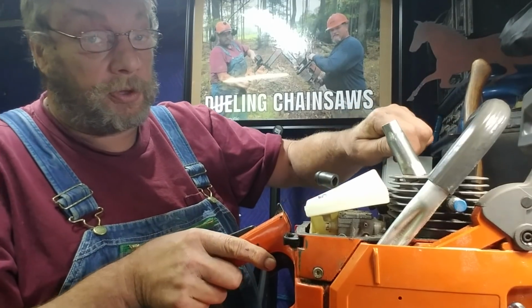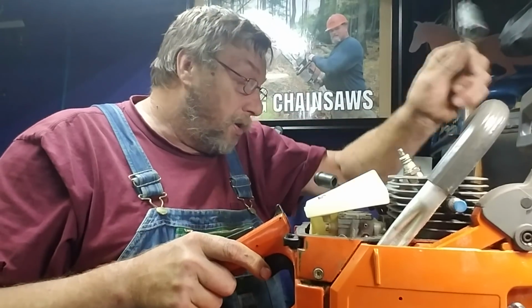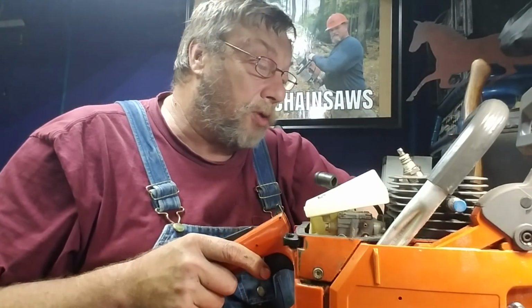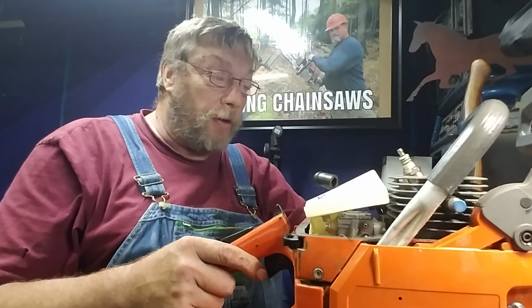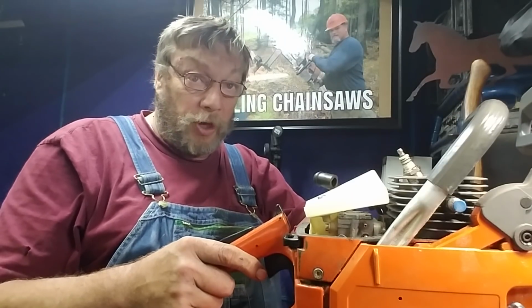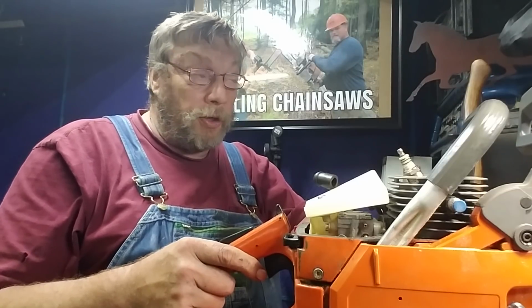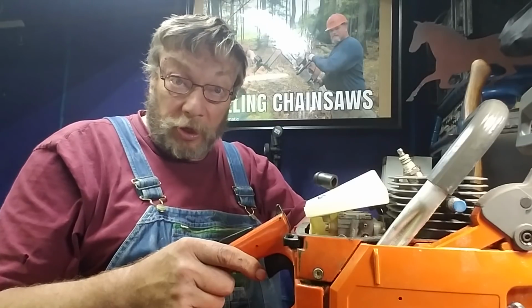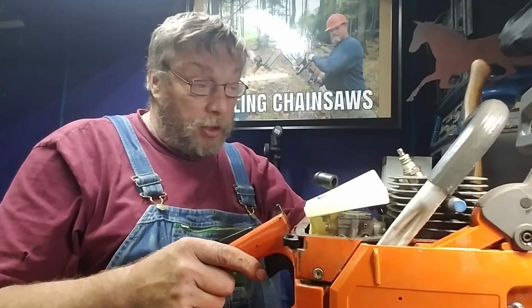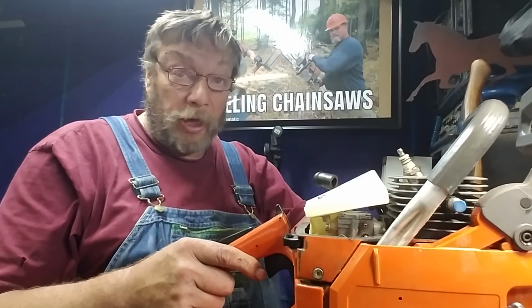I hope that helps some of you when you're playing with these. But don't mess around and try to use regular automotive silicone to put these together. They don't stand up. I have used a high temp red before in an emergency. But you're better off going to a motorcycle shop and getting the silicone they use to assemble bike engines. Yeah, it's worth what you pay for it, believe me. You'll never have any problems.